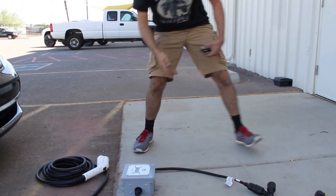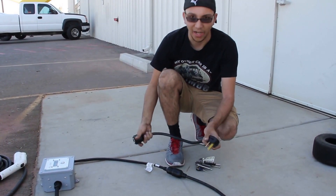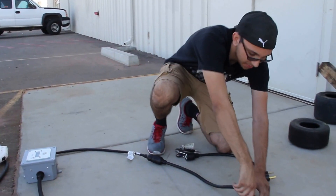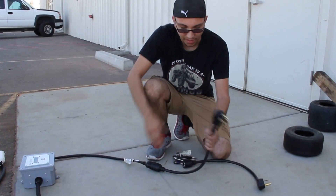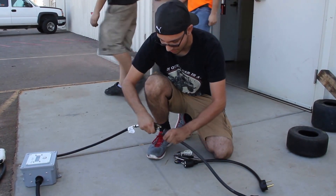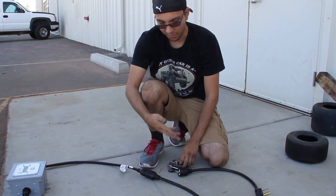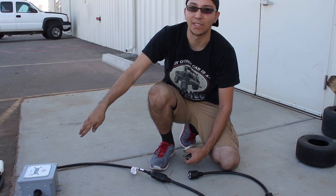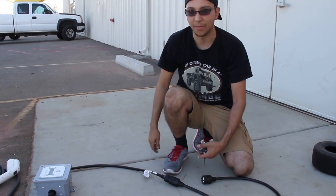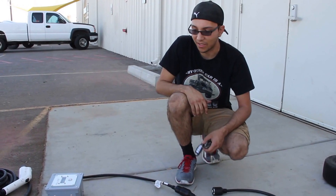The great thing about the OpenEVSE is it's infinitely adaptable. When I go to my mom's house I use this cable that plugs into a dryer socket and I can pull around 23 amps. When I come here to Locomotors I use a welder cable and can pull around 30 amps from a 50-amp NEMA socket. You just plug it in and twist it for whatever type of power you want. Once plugged in, it does a self-check — checks both relays, communicates to itself, and determines the amperage and voltage coming in using a little coil inside.